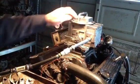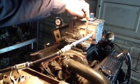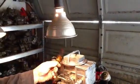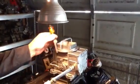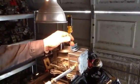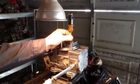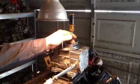That's baloney talk. There's a screw down in there. Takes a slotted screwdriver like that. Down is rich. If you're on the wall like that and you get a little hesitation, bring it down a little bit. If it's too rich, you take it up. You only move this thing no more than about a turn either way.